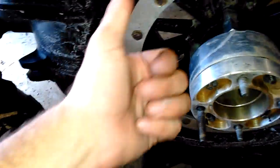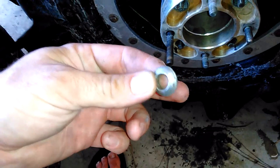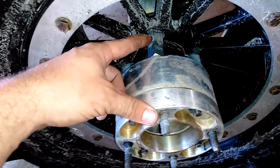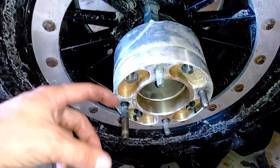You've got to get the aluminum, not the aluminum, you've got to get the cone-shaped washers. They look just like this. I'll post a link to them in the description. You've got to get the cone-shaped washers. You've got to get the stud wheel spacers. I'll post a link to that as well, the one I use, the cheapest, nicest ones. And you've got to put the longer stud in your outermost spacer.